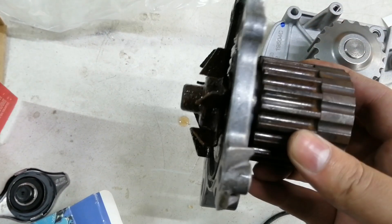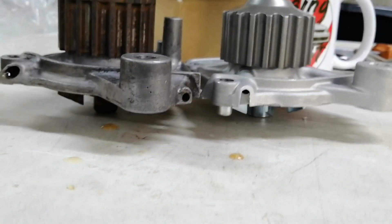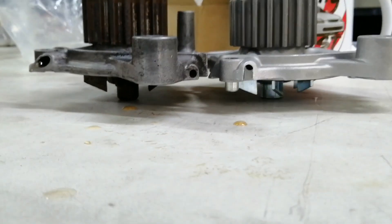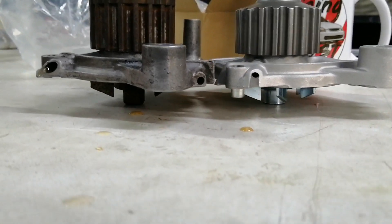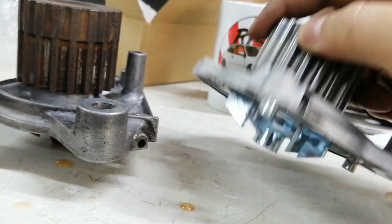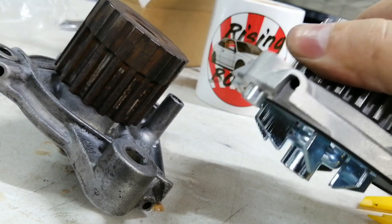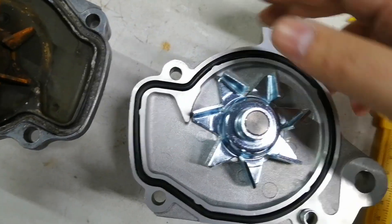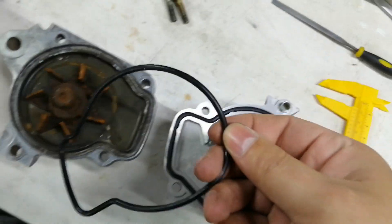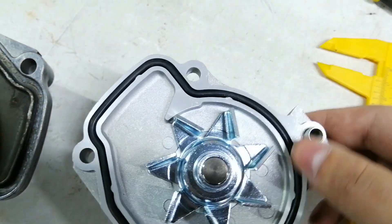Putting them side by side it looks like the belts will run in the correct place. I was worried this one has a more aggressive wheel, but it actually doesn't sit as deep — the original one sits deeper because the mounting face is higher. So this one will sit slightly out. I was thinking the fins might touch the inside of the block, but these fins are much smaller than the original ones. I put the seal that came with the pump in — it's a bit fatter than the one I had, which I think is a good call. These little tabs keep the seal in place so it doesn't fall out during install.